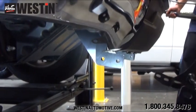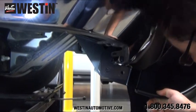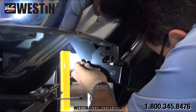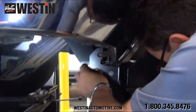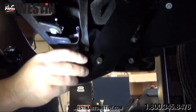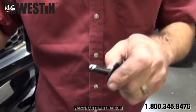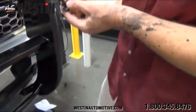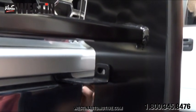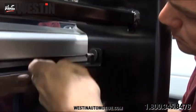Now with assistance, please take your grille guard and place it in between the previously installed support bracket and mounting brackets. Once we have the grille guard placed in between the brackets, go ahead and use the mounting hardware that is included with your kit and loosely attach your grille guard to these brackets at this time. Here is a view from the other side of the bracket showing the rest of the hardware being attached. Now we can attach the grille guard to the upper support brackets, but first we must coat the threads of the hardware with anti-seize to prevent them from galling or seizing, as they are stainless steel. Now take your grille guard, align it with the upper support bracket, and then loosely attach the hardware.